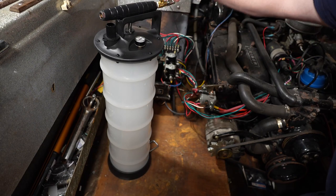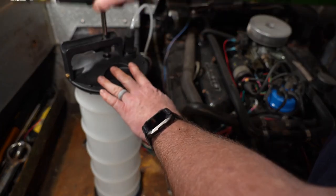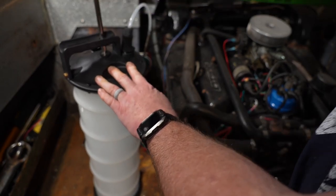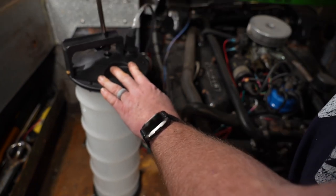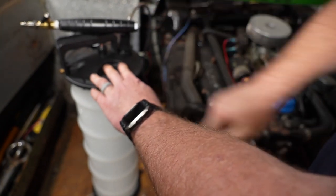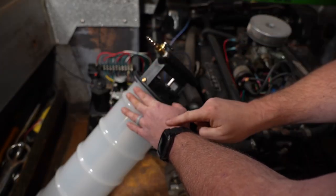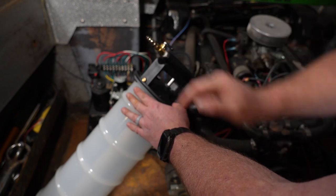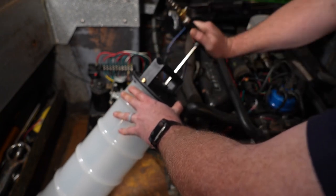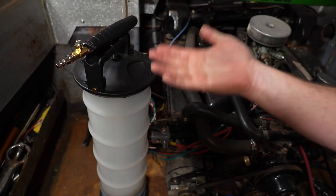Now that we have fed the hose through the tube of the dipstick, we're going to pump until we start seeing oil and then continue to pump until there is no more oil in the oil pan. You can already see that it's already pumping the dirty oil into this particular pump. Because we've created a vacuum inside the tank it is still currently pumping — you can kind of hear it going in — but you're going to want to continue to pump to keep the vacuum inside the container up so we can get all the oil out of this engine. If you had access to an air compressor, you could put the fitting right on the end of the handle, open up this valve, and you wouldn't even have to pump it — it would do it for you pneumatically.